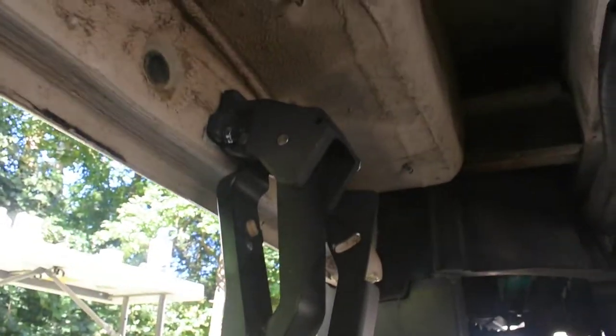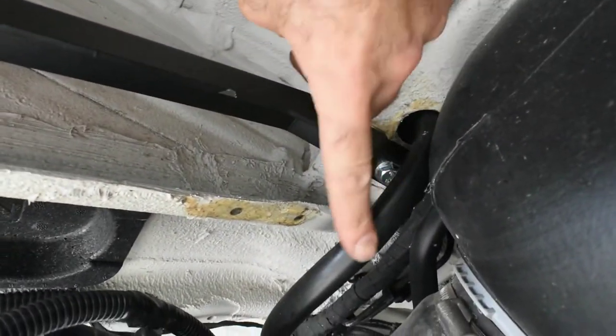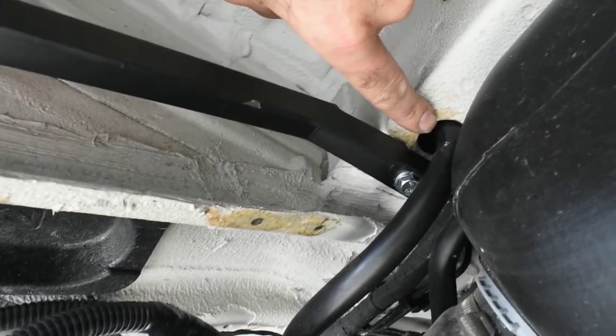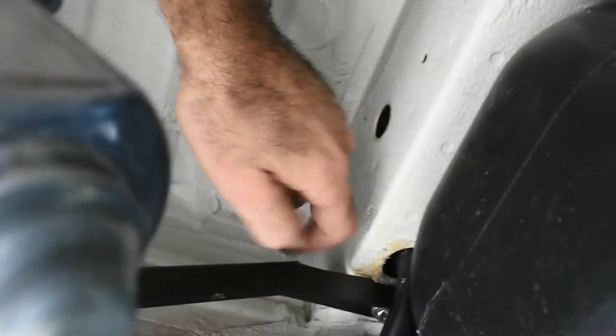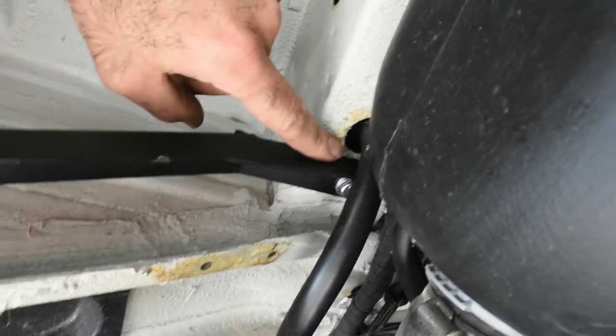Installing the brackets on the driver's side is supposed to be the same. I got the front one, which is just the idler with no motor, bolted on up here. The driver's side rear bracket is a little bit weird because there's this hard plastic tube right here. Basically, it just pokes up into that hole in the frame and terminates right there. So all you gotta do is just pull this guy straight down and push it out of the way so you can drill the hole and install this bracket, then put the tube back afterwards.